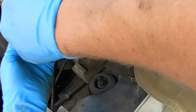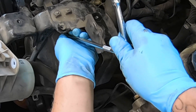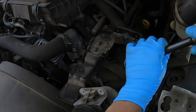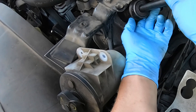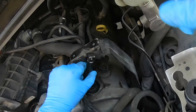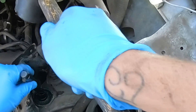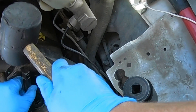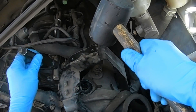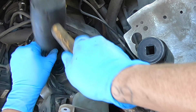Driver's side — P0020, P0021. And if you also have a P0022, that might be caused by this solenoid failing as well, but it might also be a wiring issue. You can see the large socket is too big to use under the bracket — you might want to remove that bracket to help. I'm softly tapping the grommet down, trying to do it equally on three sides of the circle, making sure it was clocked properly so it fits snugly into the valve cover. Then we put the power steering reservoir back on, tighten that down, and get the intake put back on.